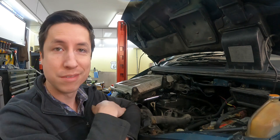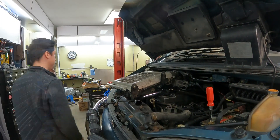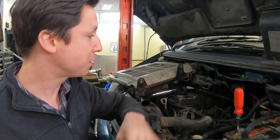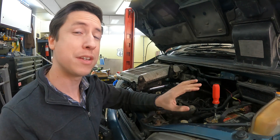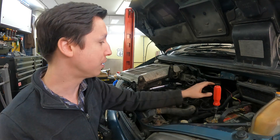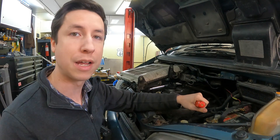Before we start testing the glow plugs themselves, it's a good idea to check that you actually have voltage on the glow plug bus bar. If you don't have voltage there, it doesn't matter whether your glow plugs are good or bad — the system's not going to work. All we're going to do is take a test light, stick it into the negative battery terminal, take a clamp, and place it on the bus bar. Then we'll turn the ignition key. We saw it light up, so we know we have good voltage going to the bus bar. I prefer the test light here because this circuit does take load — a voltmeter might tell you it has 12 volts, but it won't tell you how much amperage is going through. If this light lit but very dimly, we could have a resistance problem in the wire or a problem with the glow plug relay itself. Because it lit nice and bright, we know there's plenty of amperage going through the system.